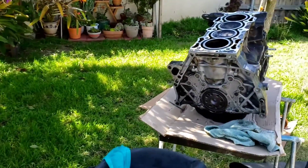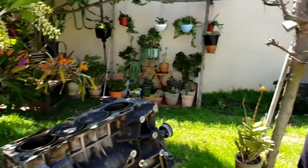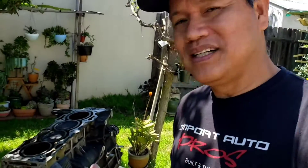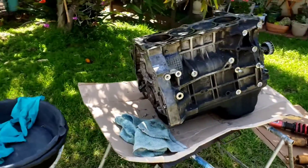So that's the plan on this one. I'm gonna strip it out and clean the block. I'll decide if I want to get it re-sleeved. And the reason I'm doing this out here is my engine stand is occupied. I'm just gonna tear this thing apart and clean it, then send it out to the machine shop.